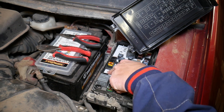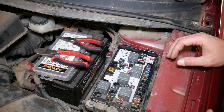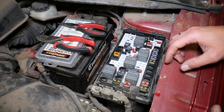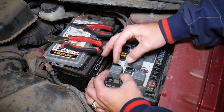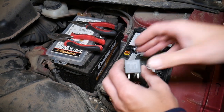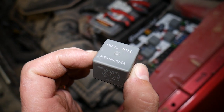What we need to check is the relay for the blower motor fan. It's super easy to get to — it's relay number two. This is the relay right here. If you need to buy one, we have the link in the description below. Grab it and pull it out. That's the relay and that's what it looks like. We have the part numbers and the replacement one in the description below.